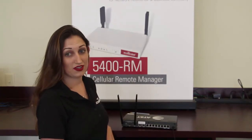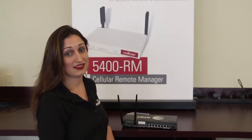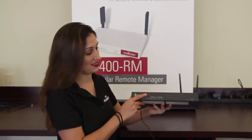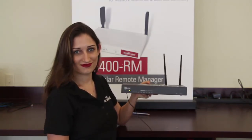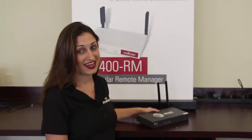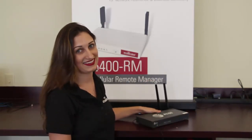Now step back and give the unit a few minutes to complete the process. All LEDs on the front will be off except the power when the process is complete. Congratulations, you have just reflashed an AT&T U110 to factory settings. Thanks.